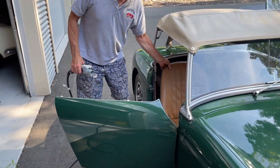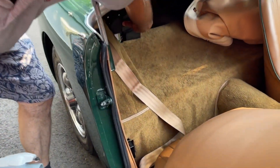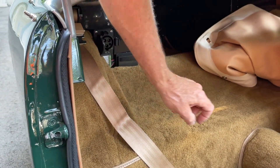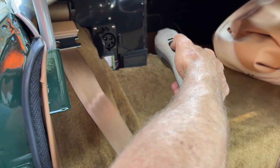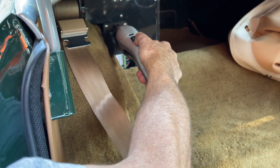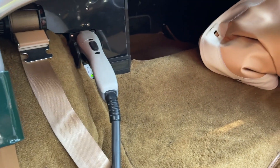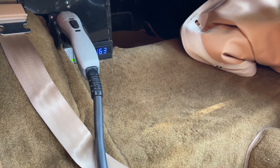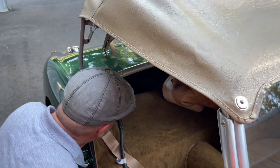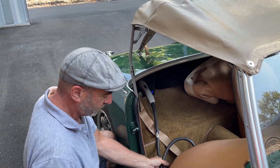Anyway, for this little video I just want to show you how this is engaged. So we have our 220 port, we flip open the little cap, we take this gun, we're mindful of the cord so it doesn't scratch the rocker. Hold the button in, press it in, let go. We hear the contactor and the charger engage. We see we have 163 volts and we should have a green light on the panel to the left, and that tells us the juice is flowing. If we leave it here for 10 to 15 minutes it'll jump up to 164.